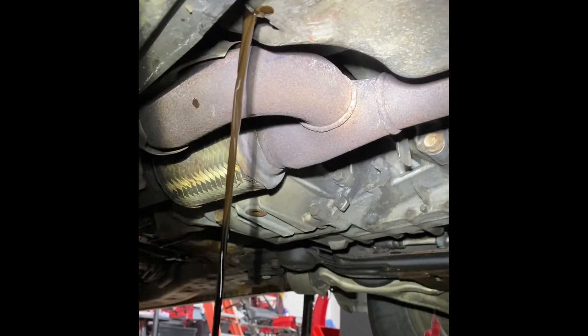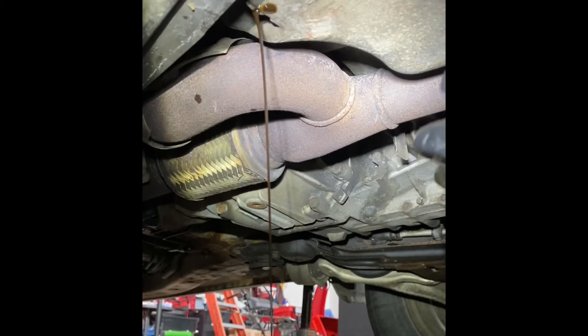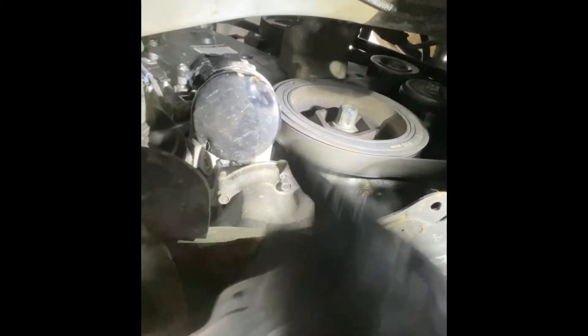I think that was a bit of sludge that just dropped. I'll leave the drain plug out because I'm also going to flush through some oil — it doesn't matter what kind as long as you flush it through. I'm going to flush with 5W30 even though this vehicle recommends 5W20, but I had that sitting on the shelf. I'll flush through the engine to make sure it's nice and clean, then let it all drain from the oil pan.